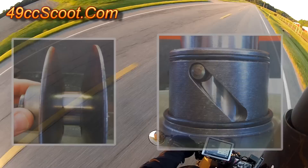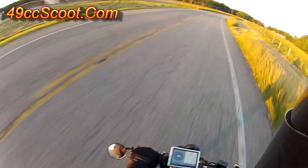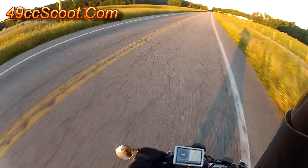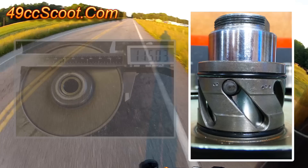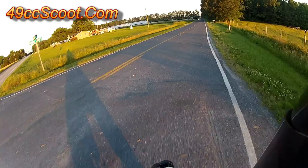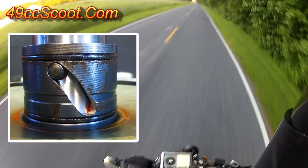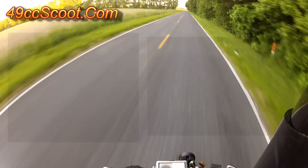The 139 QMB pulley would not be my choice over even a stock pulley. It's not large enough to have any overrange effect, too wide with a standard Minarelli belt, and had fitment issues. It's cheap and has straight torque driver grooves, but its performance wasn't on par with even a modified stock pulley. The Hoka rear pulley outperformed its stock-sized counterparts with a fairly tight RPM spread, but it's of no use as an overrange pulley. If you're just looking for a straight groove torque driver to control RPM, consider buying a torque driver alone that works with a stock fixed half for less money. The modified stock rear pulley worked fine with standard length belts, and it's hard to complain about something free if you've got the time and tools, but again it's not a replacement for an overrange pulley.